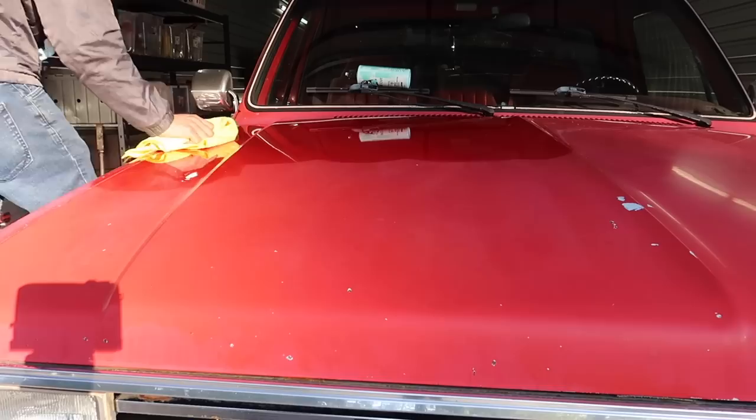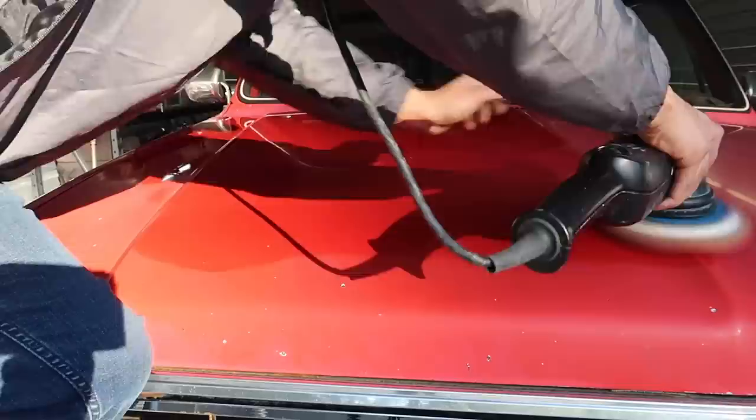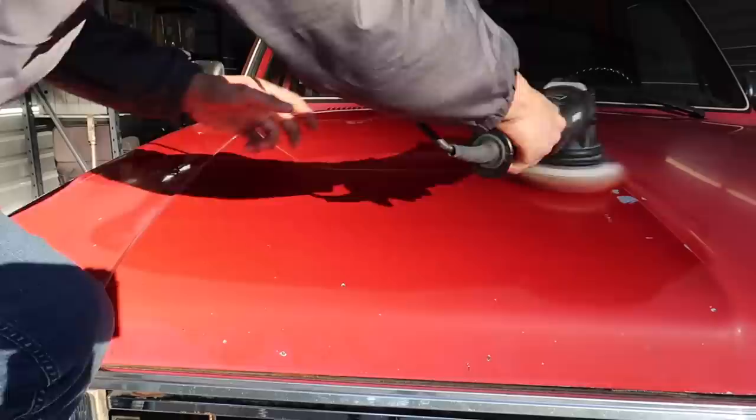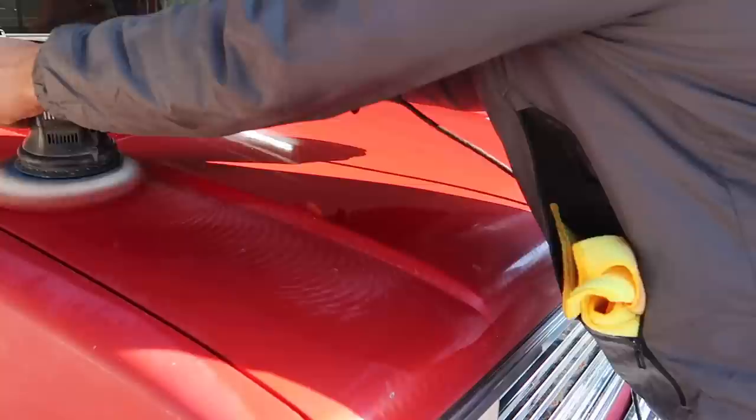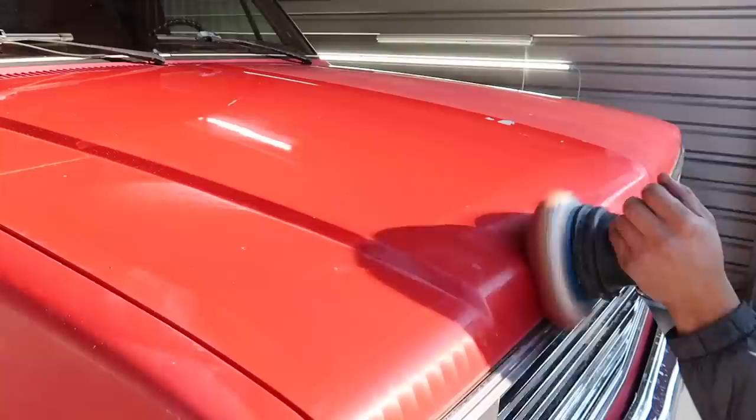But as you guys can see, I got a lot of shine just for the first cut, and then I went back with some polish and just played around with it. I ended up using various different techniques. I went through microfiber to some open pore foam pads for this, and they all seemed to work pretty well. The best combo I got was using a two-step polish, so a microfiber pad on the paint and then a polish with a yellow pad, and I got some pretty good results, as you guys see later in the video.